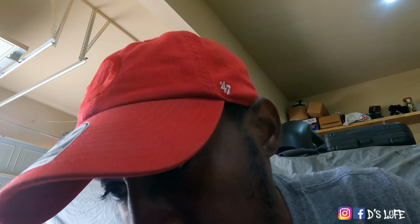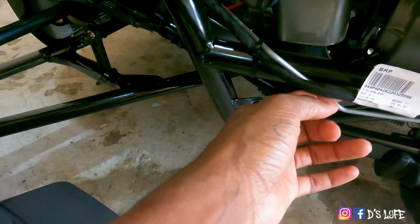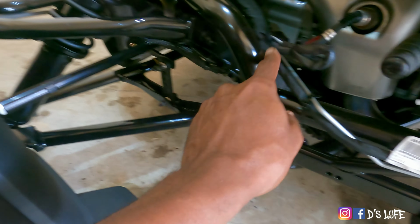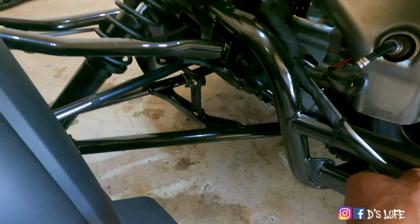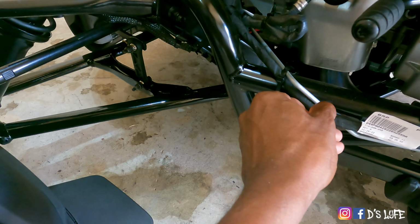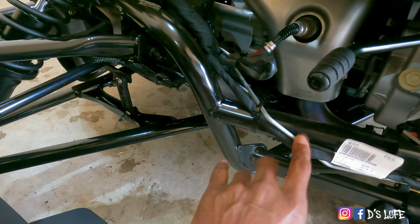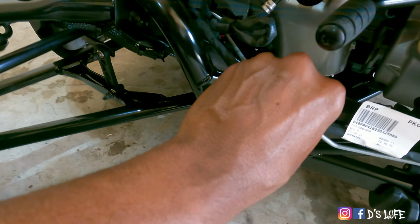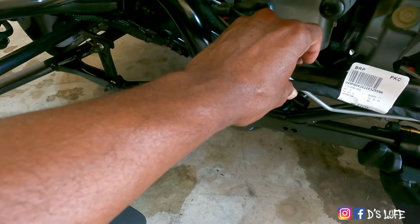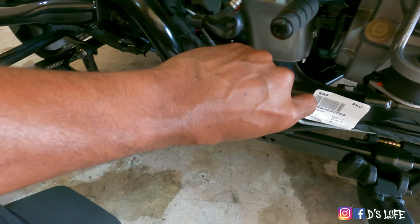First thing I'm gonna do is figure out the brake light wire, and I'm gonna go ahead and pull back the tab on that and tap in, which it should be in this line here. You see the big harness up top here, so I'm probably gonna do it right in here somewhere. Peel back a piece of the tape right in that area, tap into my wire, which it should be a white wire from what the video I watched said, which I'm gonna give credit to later on, so you'll see it down below.